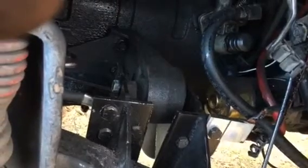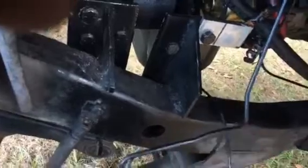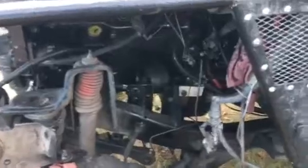Don't mind that. That's something I was trying out. I was waiting on ground cable connections, and I didn't have any big enough, so I just made that work. But that'll be going. I'm not really happy with how these motor mounts turned out. Obviously I'm gonna put metal across the top here, just to help support it, to keep them from bending and twisting. Do it on the bottom and up the side, and then probably gusset it down there, and maybe even here if I can, just to help keep these as firm as possible. I went with 1/4 inch metal. That's what was on the Dodge.